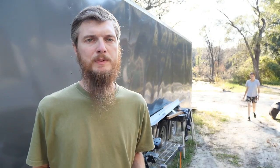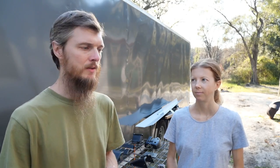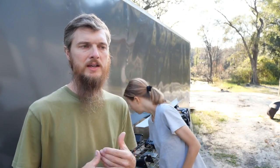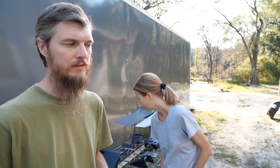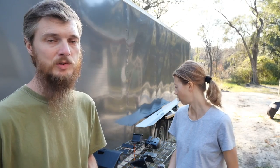Well, Ashley got those pieces painted up beautifully. The paint is drying. We're going to give it about one to two days to cure for the paint to harden before we install it. If you try to install something with fresh paint, it's very soft and you'll probably bang it up and get scratches. The finish is so smooth. It's black, it's got a nice satin finish. Do you like it? It looks like new. It looks crisp. Awesome.